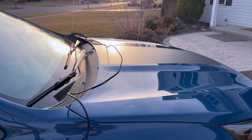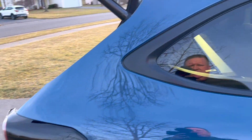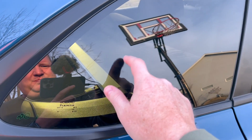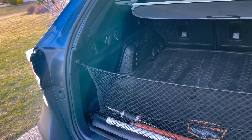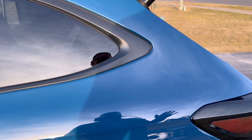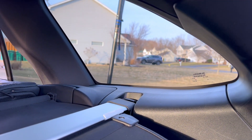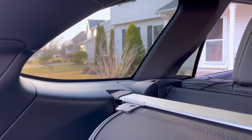Whether I do the ditch lights or another Comet bracket on the other side, I thought I'd have a 3/8-24 mount so I can use Hamsticks or the 17-foot telescoping whips I like to use portable - I typically use those with a mag mount on the hood. The other option, and I know Big Jeem and some others have feelings about glass mount antennas, is putting a glass mount antenna on either side. I saw a Subaru - maybe a Crosstrek - at Hamvention 2024 that had a glass mount antenna on that little black window.